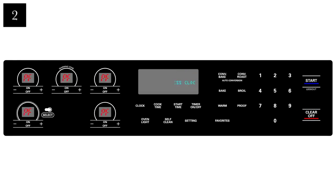When your cooktop elements display shows a PF message and your main display shows a flashing clock, press any cooktop element on-off key, then press the clear off key on the oven controls to stop the flashing. If the time needs to be reset, press the clock key and reset the time.